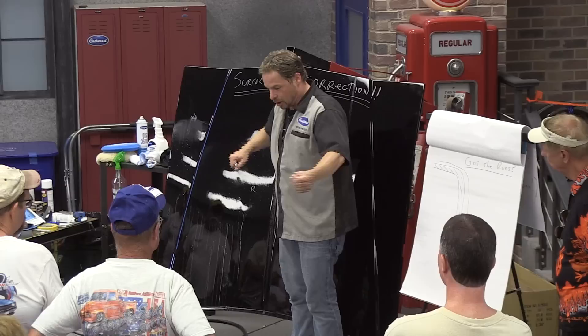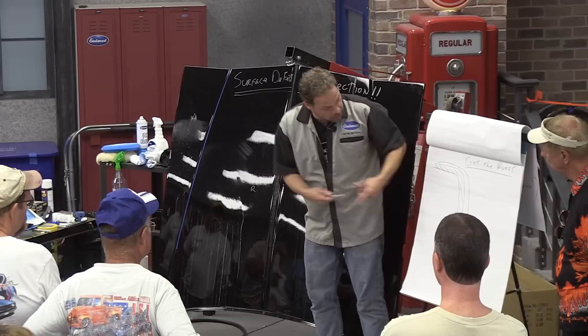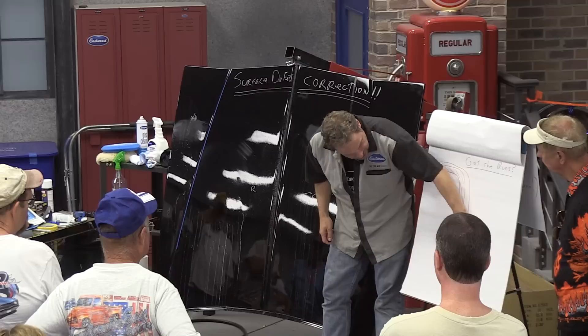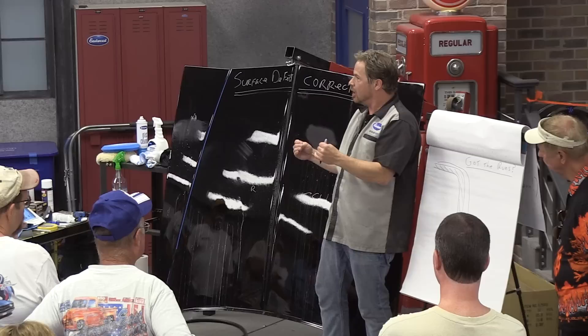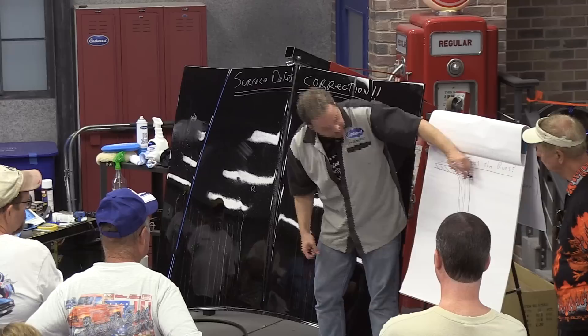When you get a paint run, surface tension is involved. What happens is it bulbs out and actually gets thinner on one or both sides of that run. So if you take sandpaper and just sand around that run, your contact patch goes all the way around it — and technically you can cut through and bust through the paint on either side of the run without having removed the run itself. That's why I like surfacing from the top down, focusing on the run, and essentially planing that run down until we've achieved flatness.